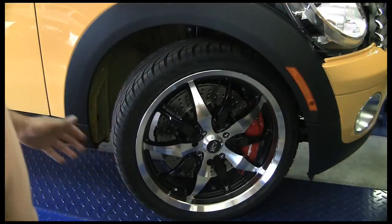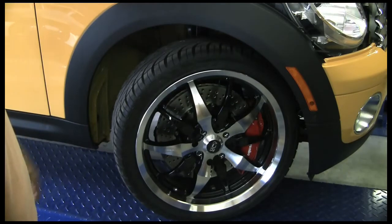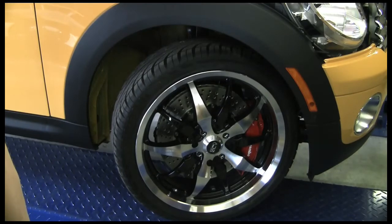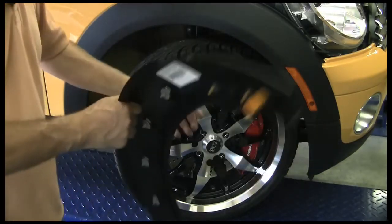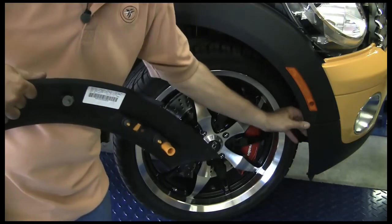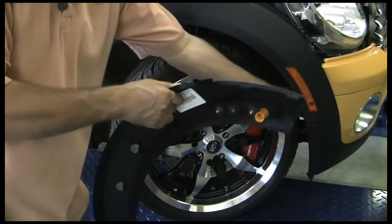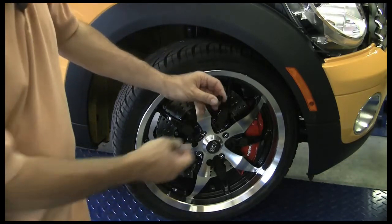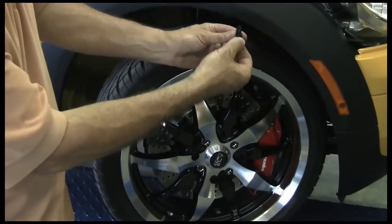What we're going to do here is take off the wheel arches — this area right here connects to the lower apron and to the side running board. We've already taken the one off of the left side, so I'm going to give you a couple of pointers. This is attached right here to this apron. There's a clip here — there's also a side marker light, and we've labeled it with its wire. You have to get a small screwdriver under there and wedge it out. It'll go ahead and release, and this will slide right out.